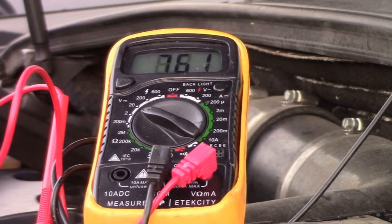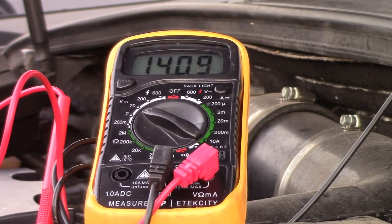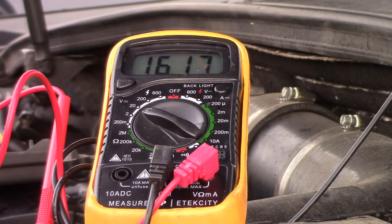So as you can see, that's 7.61 volts — poor little granddad of a battery. It's been on the car since it was new and has obviously lived a hard life. When I flicked it to the ignition it did drop to 12.1 volts — maybe it's the new radio I installed, maybe the LED headlamps or LED interior lights. But I definitely need a new battery, because while its resting voltage is okay, 12.6 is better than 12.3, and 7.61 during cranking is very bad. After cranking it did go back up to around 14.1 or 14.2 volts, which is a good sign — the alternator is charging — but the battery can't hold up under load. Best advice: if your battery is doing the same, get a new one before you're stranded. Thanks for watching, guys — stay tuned.